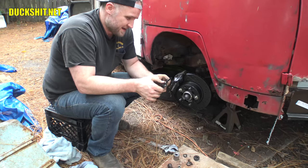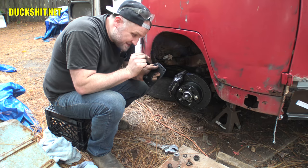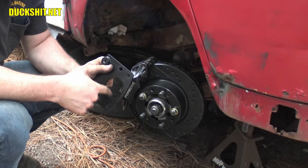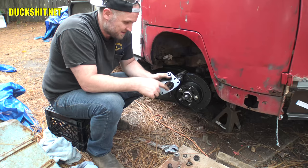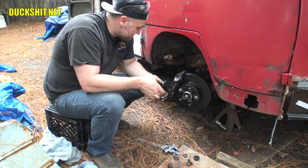I don't think it's that big of a deal having elongated a couple of millimeters — once you bolt it down it's pretty tight. What I might just do is on the side where the gap is, just get in there with a welder, fill it in just a little bit, then run a milling bit through it and round out the hole in a different location. The center doesn't really matter — the seal doesn't come in contact with it nor does it protrude into it. There it is — Porsche 944 brakes on a Volkswagen bus.